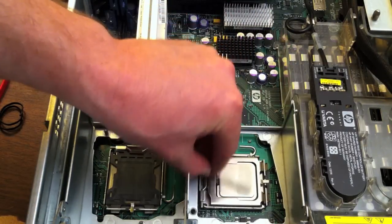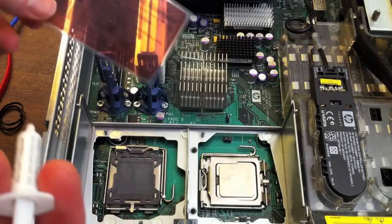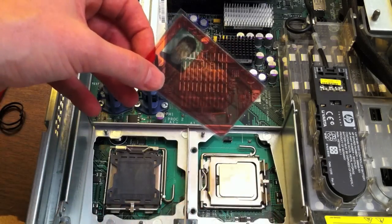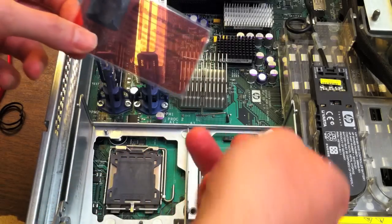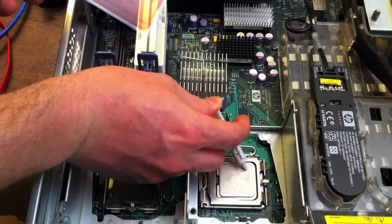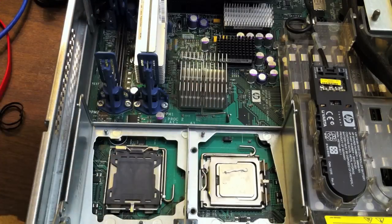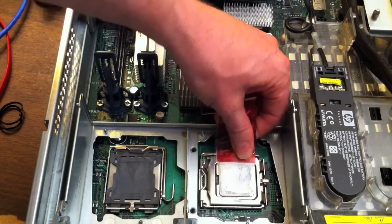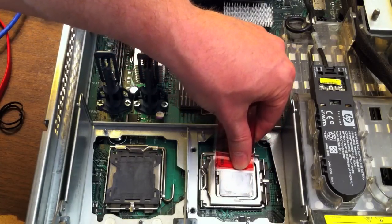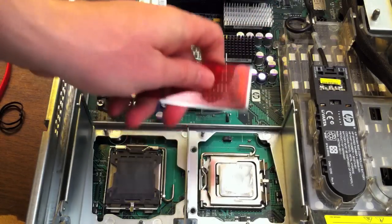Take your alcohol Q-tip and just rub it across the top of the processor. I call it TIM — Thermal Interface Material. Basically, what you need to do is just put a small blob, or a line is what I like to do, on one side of the processor. It's a little tough to do and get it for the camera, but just put a thin little blob. That's all you need. Spread it as evenly as you can across the processor — you don't need to get the whole thing.